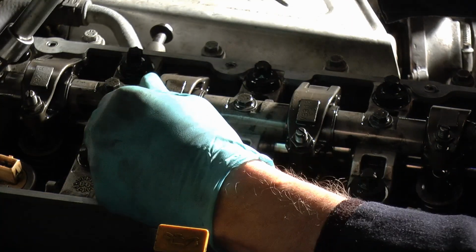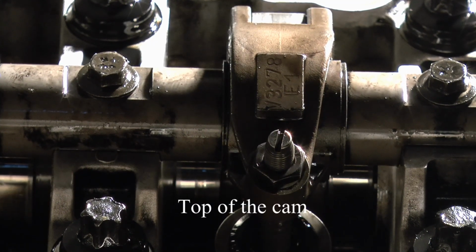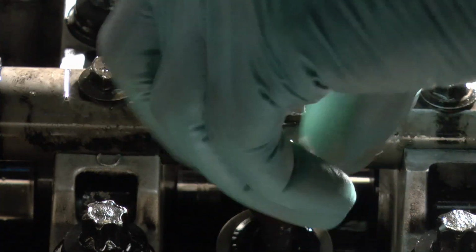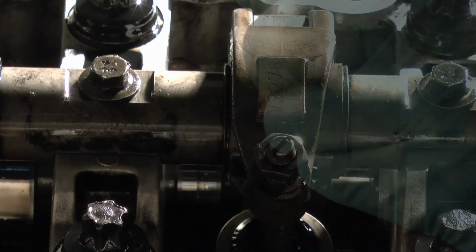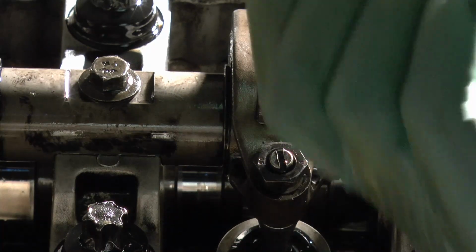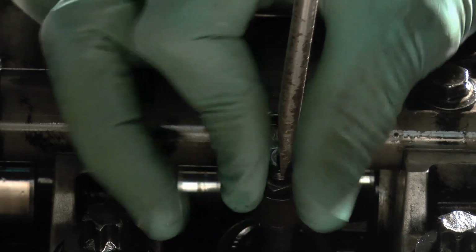Got it. Right. Here we go again. Second time, look here. Like that. And then we screw that screw back in, all the way to the bottom. Oh, what joy. Right, it's down the bottom, and you back it off one turn. That's half. That's one. And we tighten that nut up without it moving.